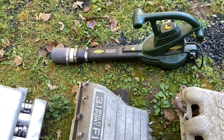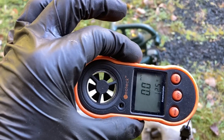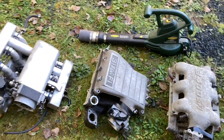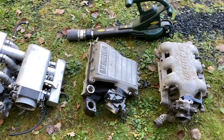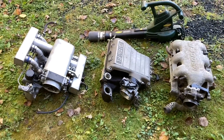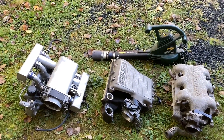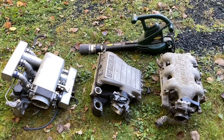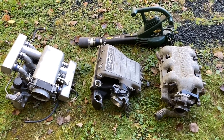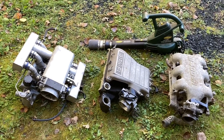The way I'm going to do that is using this cheap wind meter — an anemometer from Amazon, I think it was like $15 — and we're going to see what the air coming out of each port is as it's blowing through. This is only going to be simulating boost, but it should give us an idea of what the air distribution is between all of them. After that, I want to do a test where we block off all but one port and see how each port flows individually. For that I've got to use my shop vac because the leaf blower just puts out too much air for this wind meter. I'll get this set up and show you what that looks like.